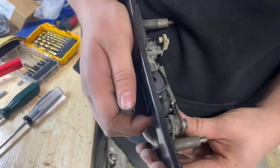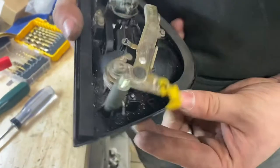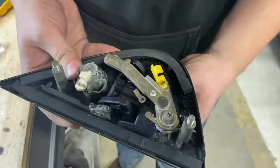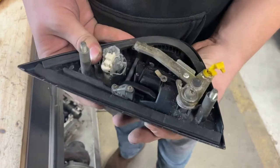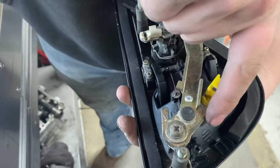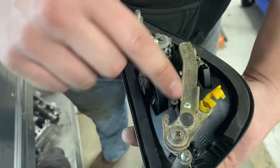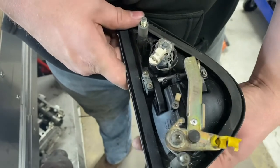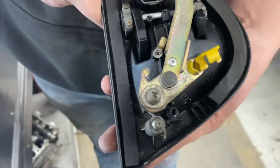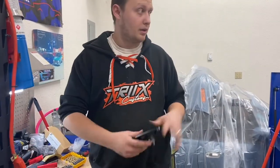It might just barely scrape but it's definitely not going to be a problem. You can see now — if you come at the door like this, you just pop it super easy. Now you can actually get in your car without worrying about breaking the door handle off. You can see how putting the rivet right here blocks the bottom metal portion from going any further in that direction, because then it would put pressure on this pull bolt. But this blocks it and changes the geometry to push down — and you can see exactly how that works right there.